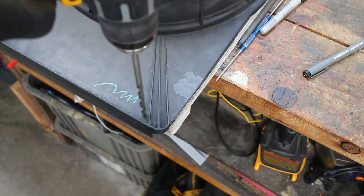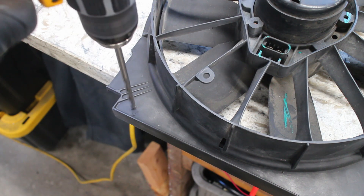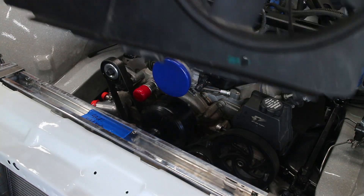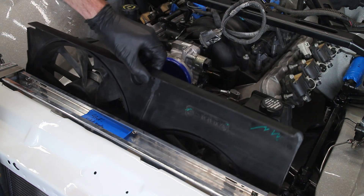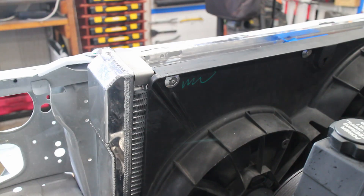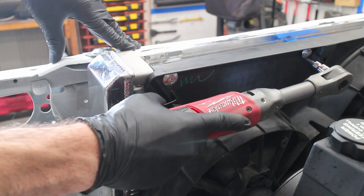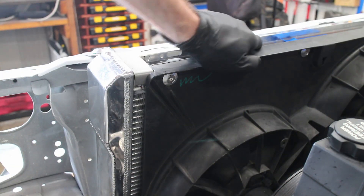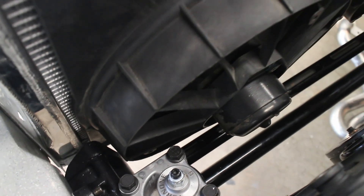I spent about $100 on these for a junkyard set. Overall, that's about one-third of the cost compared to an aftermarket fan setup, but what's nice about these factory fans is they actually flow more air than an aftermarket one. These three holes line up where the rivnuts were placed in the radiator at the beginning of the video. The fans are dropped in and secured by some M6 hardware I had laying around. The wide washers help distribute load around the plastic. It was a fairly easy job with minimal cursing — I call that a win.